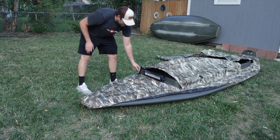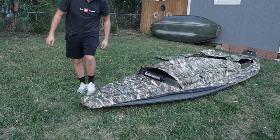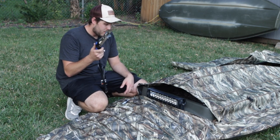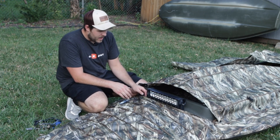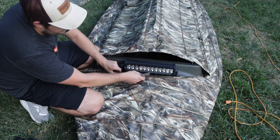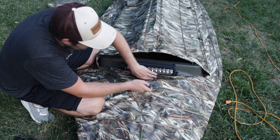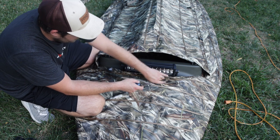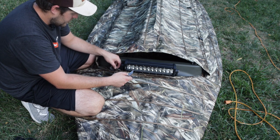What we need to do is actually do some trimming along here for the light bar before we figure out the right placement. Here are the tools I've got: a little razor blade and a heat knife — I've never used one of these before. If you cut this material you need to melt the edges, otherwise it's just going to fray and unravel. I want to get as many stub straps as I can so I'll still be able to use them — looks like I'll get one in the middle and then two off to each side, so I'm going to be losing one set of double straps completely.